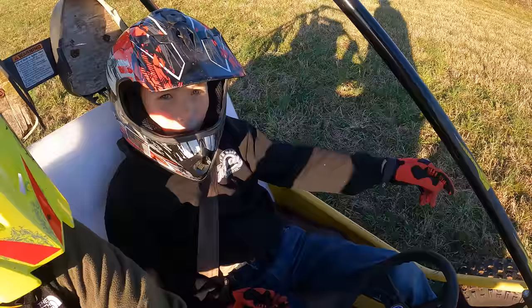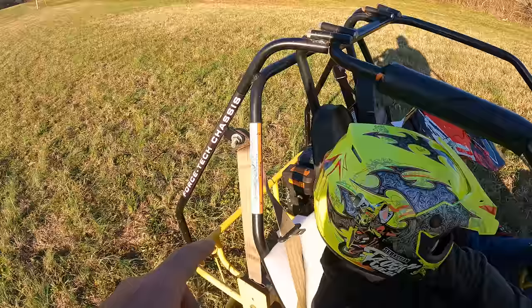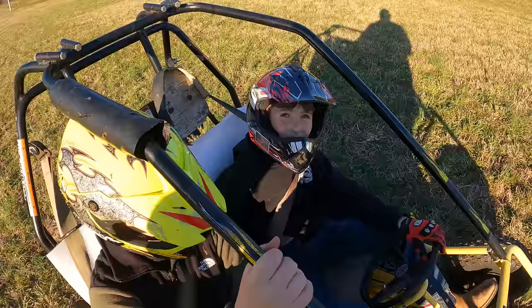Yeah, I think the needle and seat is sticky because I had to bang on it with the Leatherman when it wasn't getting fuel a little while ago. So that carburetor is not for this engine. It's some sort of swappy-ish thing. So maybe we look at changing the carburetor and maybe putting a live axle in the rear. Is that something you would like to do? Yes. Yeah. Bradley, you want to drive this thing? Sure.